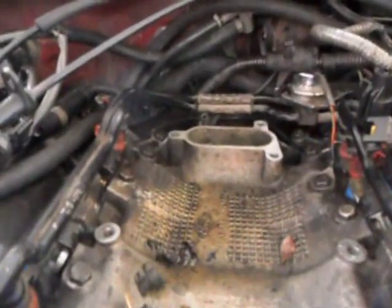And with the plenum removed, you can see I got a lot more vertical room there to move the engine up whenever I'm taking it out, because I don't want to drop the subframe again on this car. Alright, moving on. We'll go ahead and pull the fuel lines off.